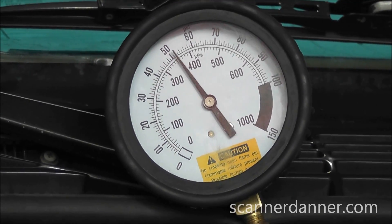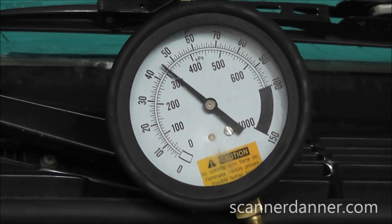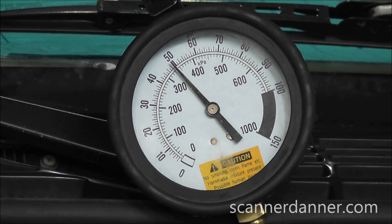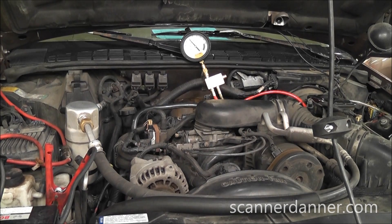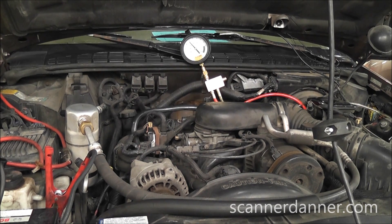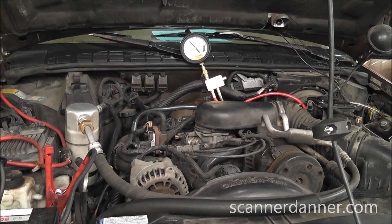Go ahead and crank it. Still not enough. But still, it's something to consider if you get these vehicles in with low fuel pressure on these CPI systems with these mechanical injectors — half electrical, half mechanical. Number one symptom: a can of carb clean on the seat is a good indication you've got a fuel pump problem. Number two: they say if I jumpstart it, it will start. Unique to this system, you need at least 50 pounds of pressure for these things to fire. So clearly we have a weak pump. Our next steps would be to check pump power and ground. These systems will not start below 50 pounds of pressure.